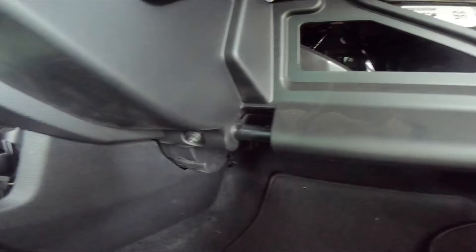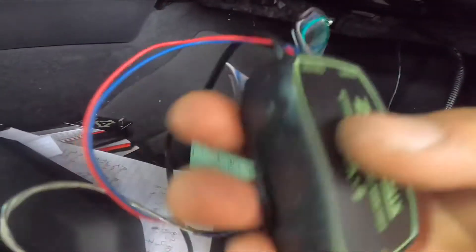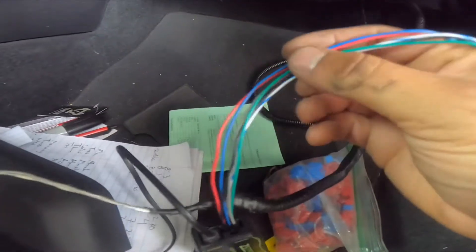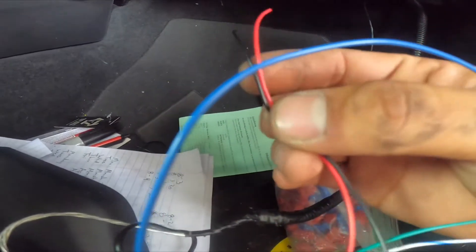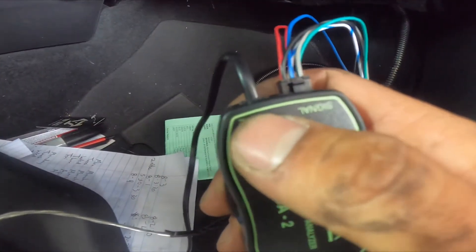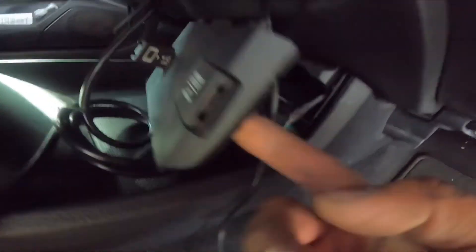I'm going to leave a little slack in the bay so it's not super tight, and zip tie the slack back here. This harness has four wires and goes on the box where it says 'sensor.' Over here, since we don't have a wideband, we just need power and ground — red is positive, black is ground — and then the other one labeled 'gauge' goes to the gauge.